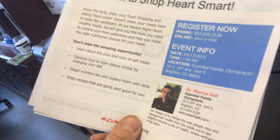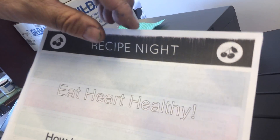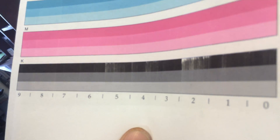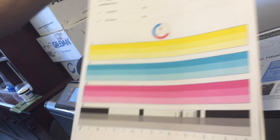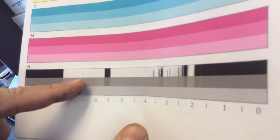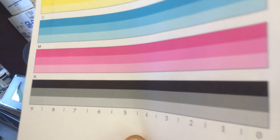You'll see something like this — basically a waterfall effect where the black drops out on the page initially, then recovers as the print goes down. So the print quality recovers, but your first page out every day may have some dropped colors. Here's another example in the print quality page where some nozzles drop initially and somewhat recover — a pretty significant quality issue. And here's an extreme example where some of the printheads on the print bar are completely clogged.